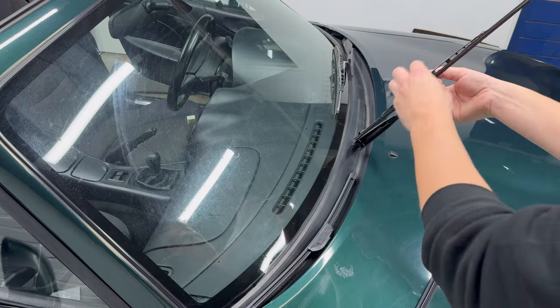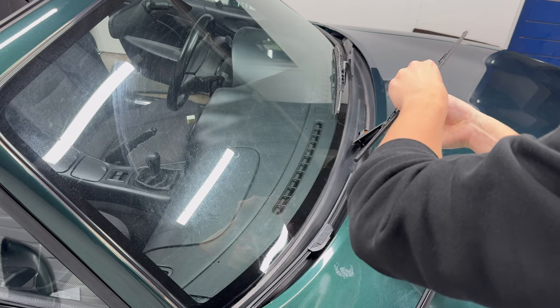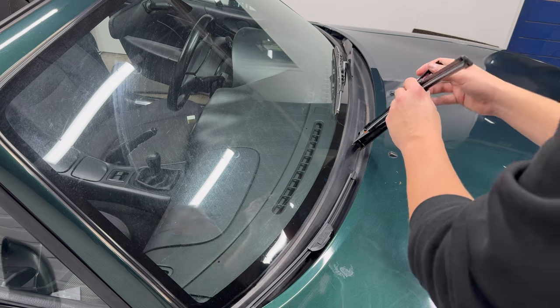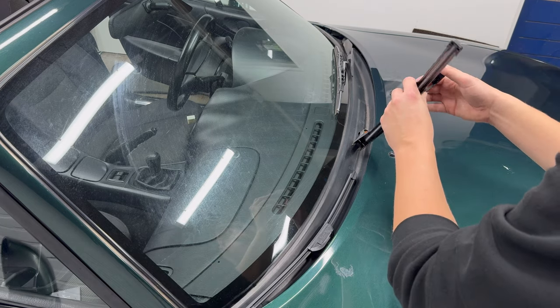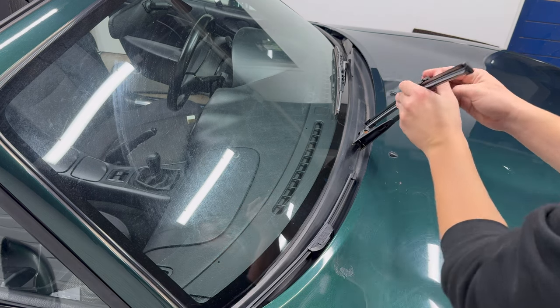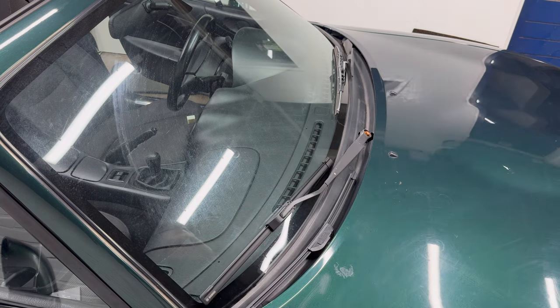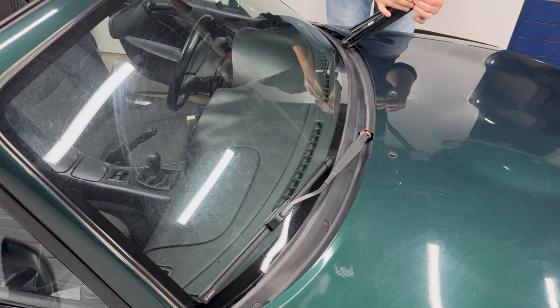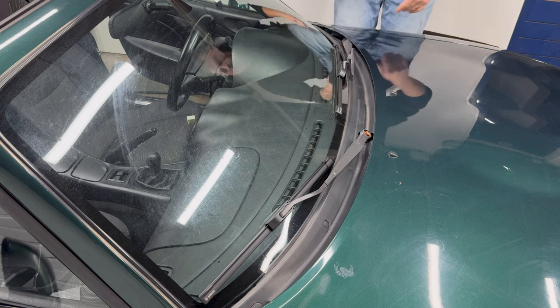Now, before we open the hood, let's replace the wiper blades, because the old ones are, well, old. Replacing them is easy. The arm is curved into a U shape that holds the wiper blade. Pull the old one off and install the new one by slotting it over and under that U shaped arm bend. These specific wipers have plastic protective covers over the mounting point. So unclip that cover, install and reseat the cover if that's the case for your new wipers as well.